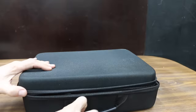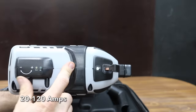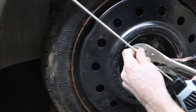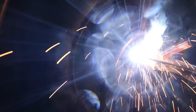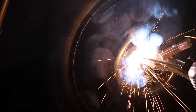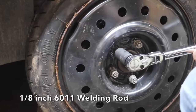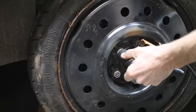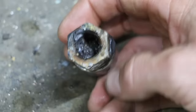I tested a handheld inverter welder costing around $140, powered by 110 volts with a dial to adjust amperage. Using a large nut held by locking pliers, I filled in the donut hole using a 1/8 inch welding rod at 120 amps maximum. There is a pretty high risk of causing damage to a set of wheels with this strategy. The weld did not hold up on the first attempt, so I started with a new nut, spent more time filling the donut hole, and added a small bead on top. The weld held up and the wheel lock came off.